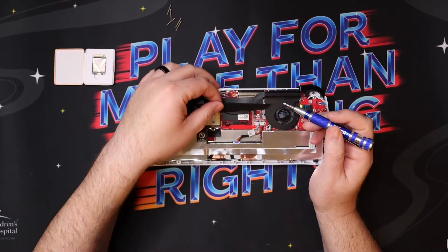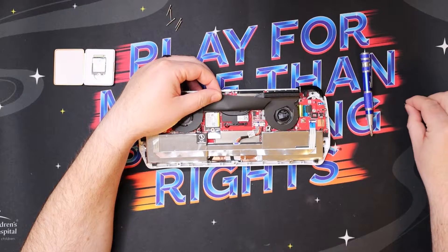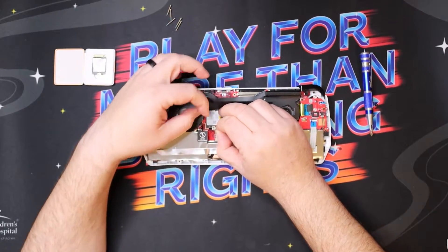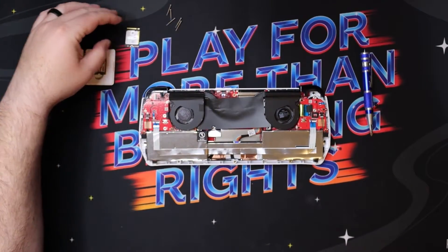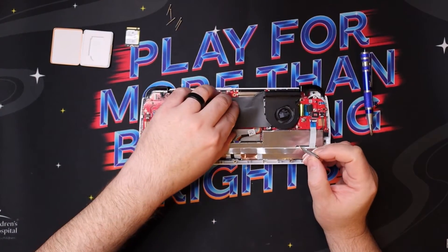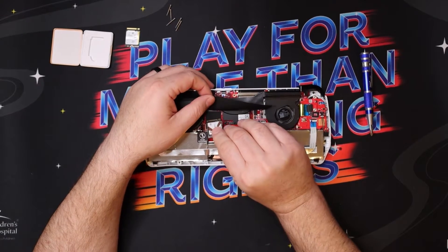With the screwdriver we'll lift this little paper up and you can see right there — that's our drive. We're going to unscrew the black screw here and that'll come out. Make sure you don't lose that screw. Popping the drive out can be a little difficult — there's a little black tab in there you can use to help pull it out over the screw area. There we go, we got that out. Just be careful of what you're touching and fumbling around with in there.